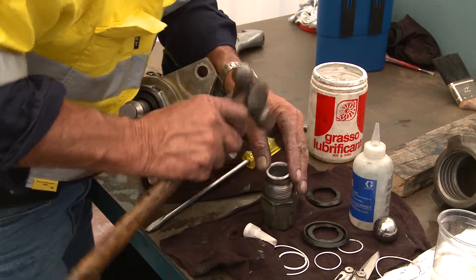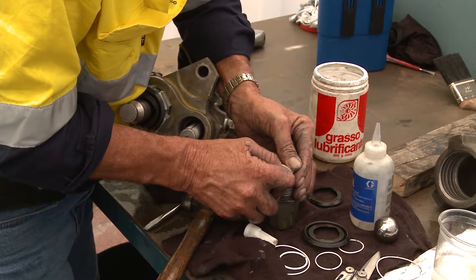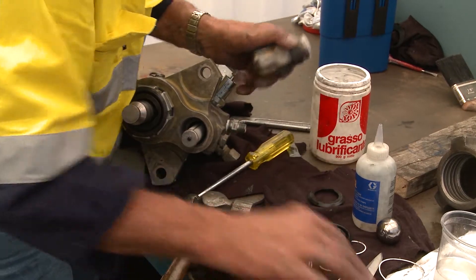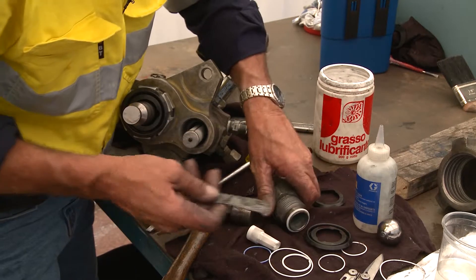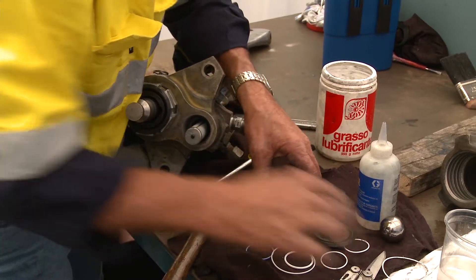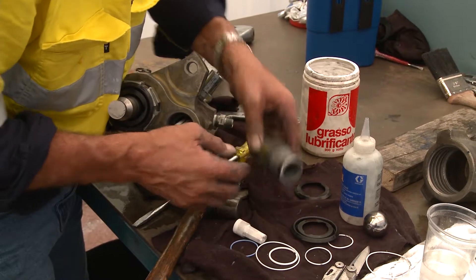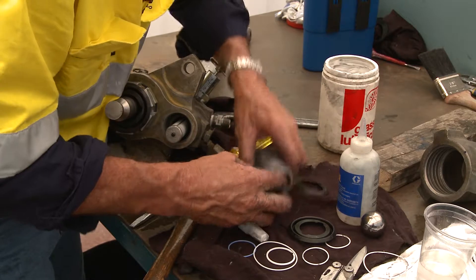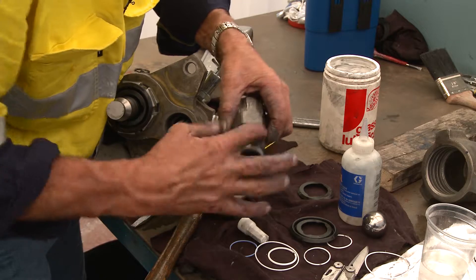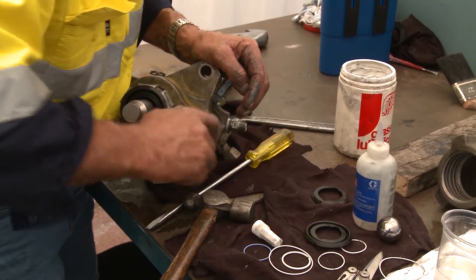There's the clean ring land. Put a little bit of vaseline in the ring land. Use a new o-ring — if you take them off and they're second-hand ones, get rid of them and put new ones on. Don't hit the o-ring back on with a hammer. Just use applied pressure and it'll click into the ring land. Now, back to the anti-seize that came with the kit — it's silver anti-seize. Slide it onto the thread.